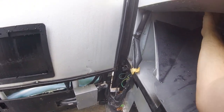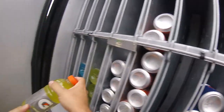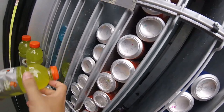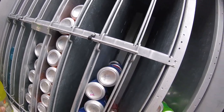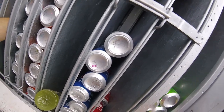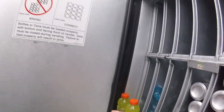I hit the service button and we had a JC7 error and a JC10 error — those are jammed column errors. Column 7 is my yellow Gatorade, so there's a jam there. But I never understood what JC10 was because this machine only has nine columns. I've talked about that in previous videos, but I think we have our answer and we're going to figure it all out and get it fixed in this video.